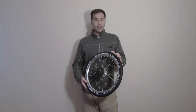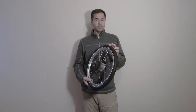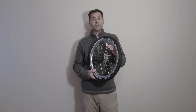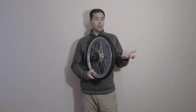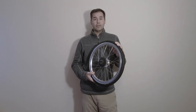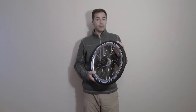After fixing the spoke, comes the time to true the wheel — and this is an art in itself, something I'm not really capable of doing myself. What I would normally do is check the tension on the neighboring spokes and try to replicate it. This should usually be enough to give you a wheel that's good enough to continue riding, and hopefully reach a professional mechanic who can check it and true your wheel perfectly.